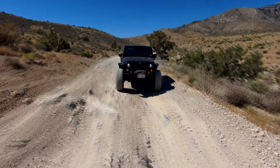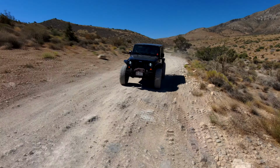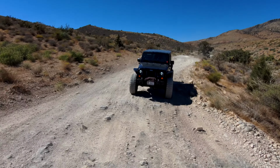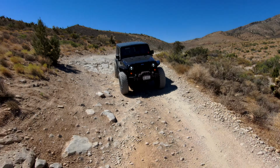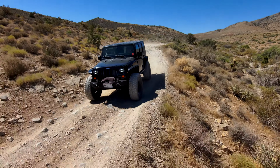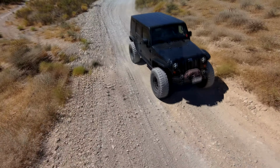So at the end of the day, you're running basically the same transmission as the 6.2. The install labor is almost the same. We do have to run a couple of extra coolers on the LT1s. So the cost is not that much less, but you're going to be in the mid to high 20s with an LT 5.3, where you're going to be in the low 30s with an LT1.